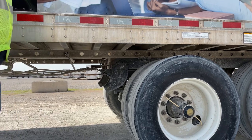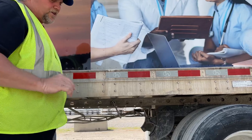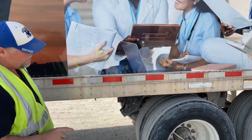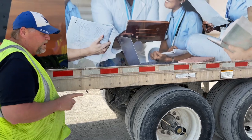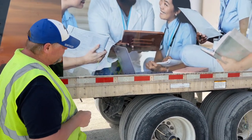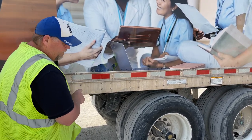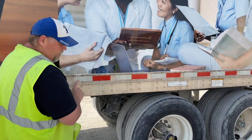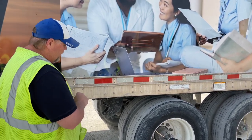This is a spring ride suspension. My springs are not bent, broken, or scissored — properly secured to my trailer with a front and back mount, which is not bent or broken. They're properly secured with all their nuts and bolts, with no rust trails or shiny spots to indicate looseness. My U-bolts are not bent or broken, and are properly secured with all their nuts — no rust trails or shiny spots to indicate looseness.